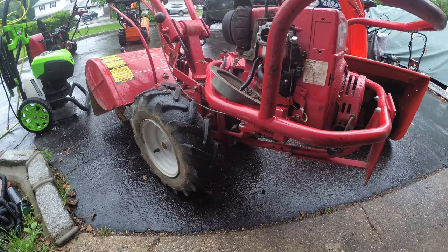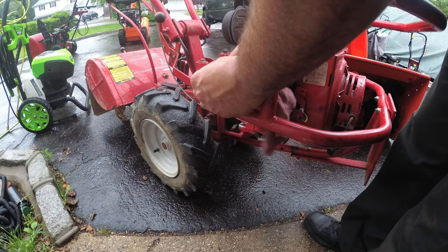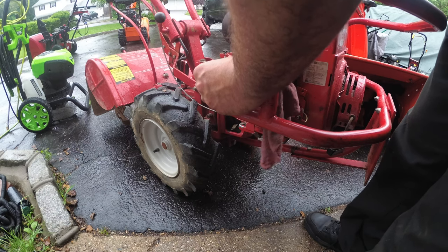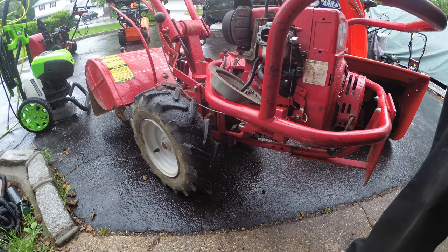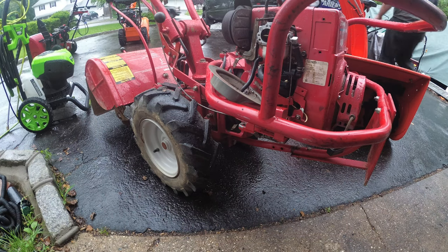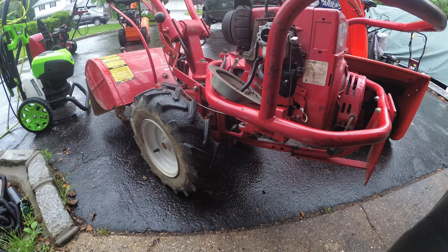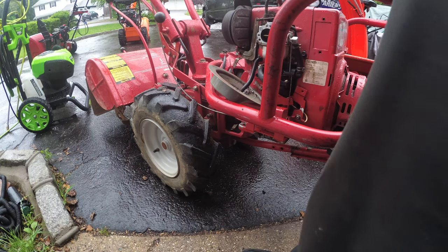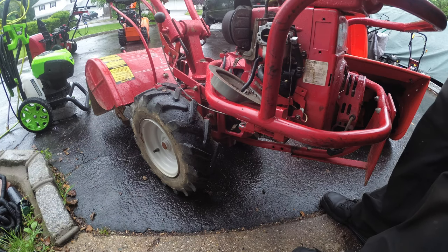So, let's wipe this stuff out. Can't believe this freaking fuel pump. You know what? I learned something new today. Hopefully you guys did too. I learned how to diagnose a bad fuel pump. I guess it's a good habit, when the fuel pump goes bad, to clean out your carburetor because, like I said, when I blew out this fuel tank, a lot of gritty stuff came out. So I'm going to put this back together, even though it could be tough, because everything just got rained on. God, I'm so happy to get this out of the way.